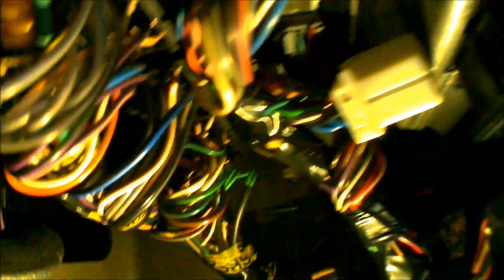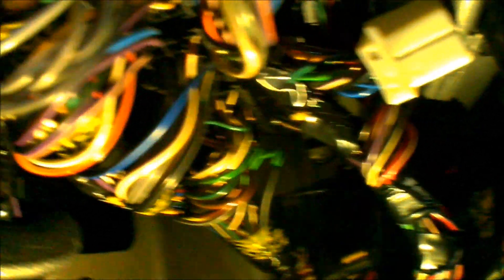This is why you can't trust everything you see on the internet. According to the guide I was following, see this white plug here — jiggly jiggly — that one — that's supposed to bring the blue and black wire in there to cut, which does something so it knows when it goes into diff lock, so it doesn't fudge up your traction control or HDC apparently. Well, it said on the thing I read it's the centre ECU, blah blah blah. When I checked, it bloody well isn't — it's the next one just there. There is the black and blue wire you want to be cutting, I believe, to trick it. I'll get that done — if you want to cut it, both ends need taping off and then leaving apparently. So I'll do that and then we'll test it.